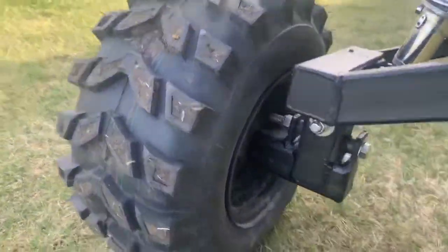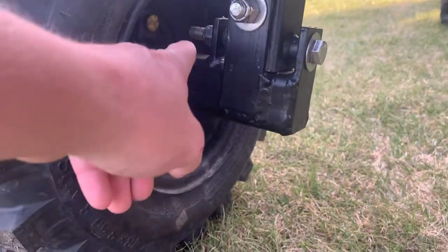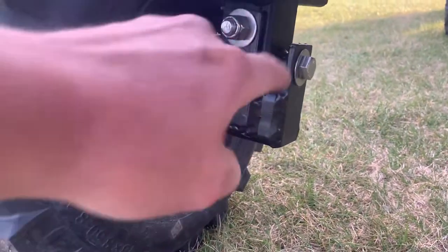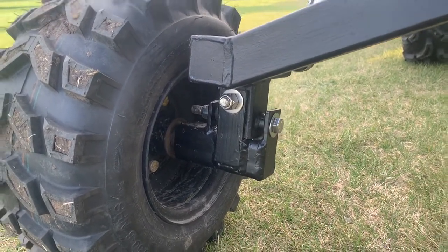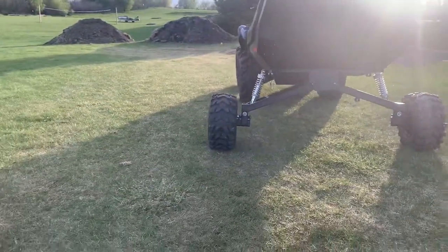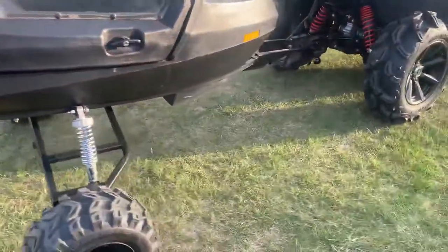The spindles I had to make. I welded them into this tube — it's actually a 2 inch tube. This is where the ski would actually have mounted, and I just drilled another hole for lateral support so it wouldn't twist off. It was basically solid onto that mount on the A-arm. The only thing I really don't like about this is the amount that it sits out from the ATV — it's a lot wider, but you just have to be cautious when driving it.